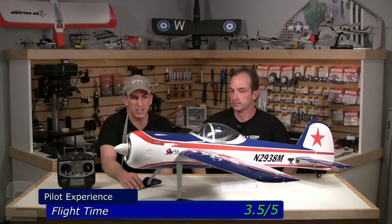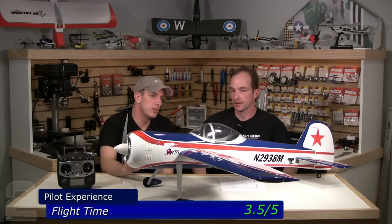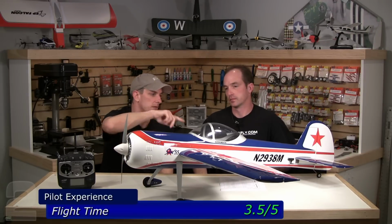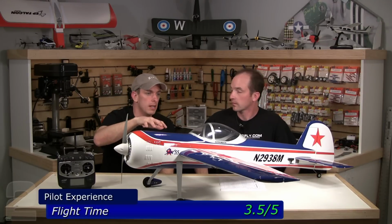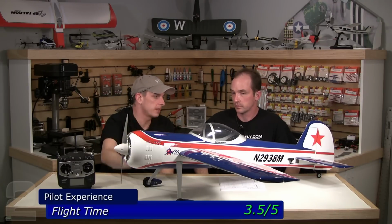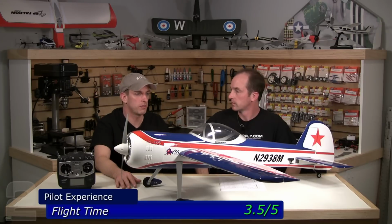Yeah. We had a 2550 milliamp 4S pack in here, and we needed more. We needed 3,500 to 4,000. If you could get a 4,000, now the challenge of the counterweight comes in, the tail weight. If you could get a 4,000 mounted in here and be able to level out that tail, or weight that tail down and get it balanced out again for you. Because if you're flying this style plane, you want CG dead on the money.